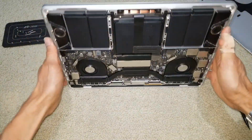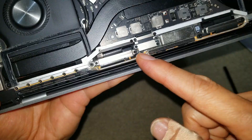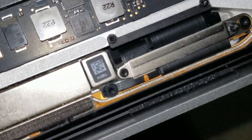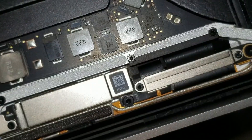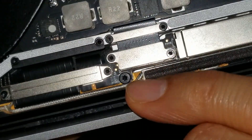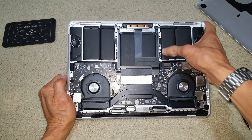If it keeps opening more, it keeps stretching out, and that's when the display disappears. That means it's losing contact. Somehow there's a break in a certain area. So you need to remove the bracket held by the two Torx screws. After that you pop it out and inspect the break or the rip. You need to remove this one and that one, and they are also screwed on with a Torx screw before you can unplug the flex cable on the bottom of the bracket. There's a bigger Torx screw as well. This is going to require micro soldering, so it's going to take a long time — find a shop that could do it.